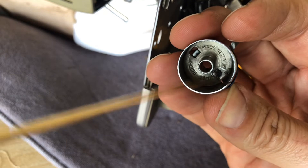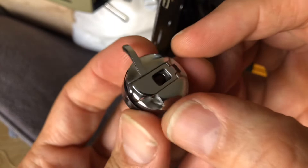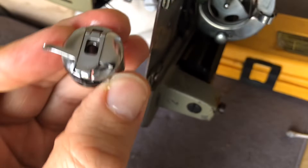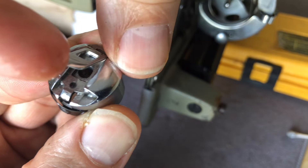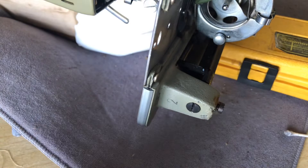Now when I do this it makes the bobbin case's job easier, because the bobbin case has parts that move — it's spring loaded. Notice when I pull up, watch how it moves. You'll see it on this side too. Do you see when I let this lever move there's a piece here that moves? So bobbin cases are more complex than you might think.